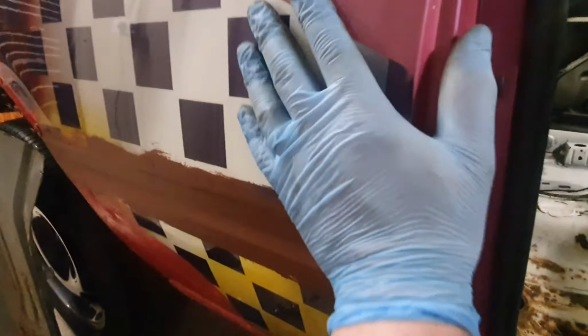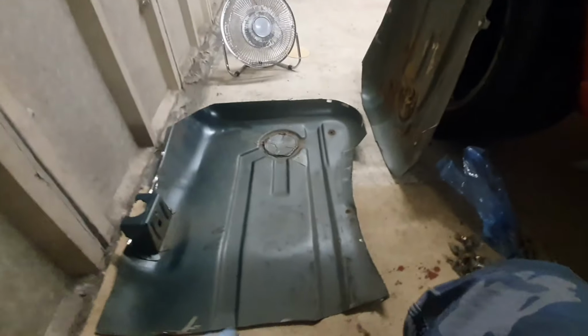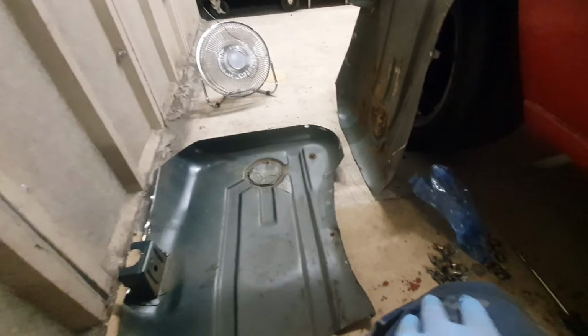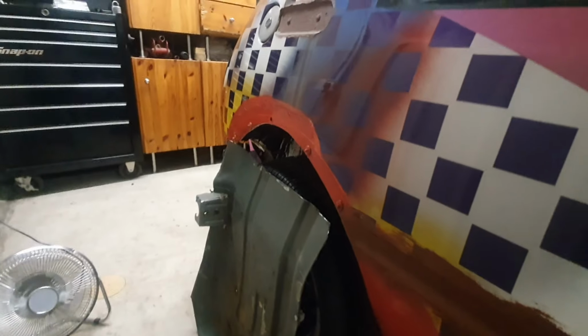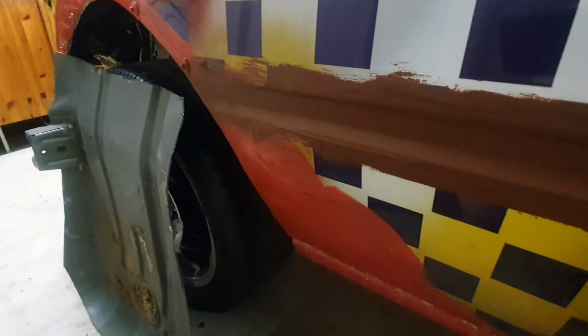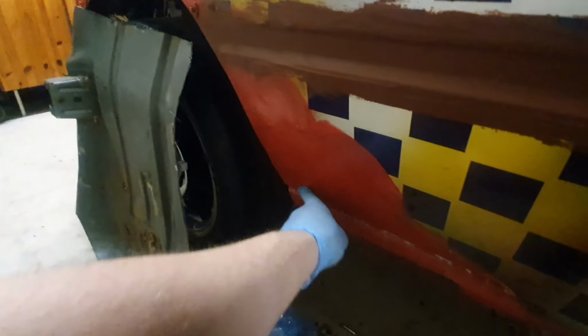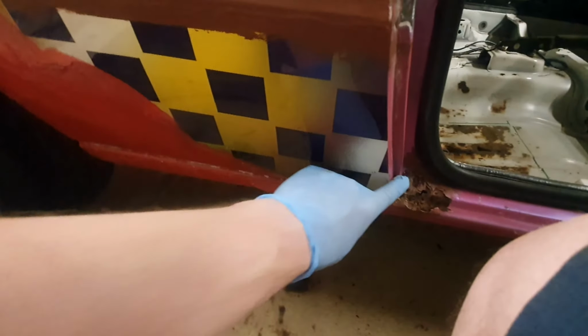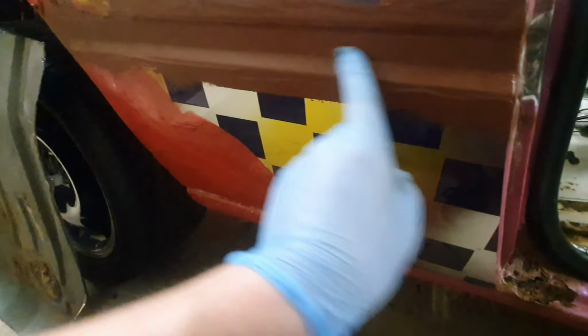So what I'm thinking is I've got two rear quarters that I bought. It cost me £100 for each side. Again, it came off a greeny coloured one, not off the same guy, which is kind of weird. Same colour car, but you know, I can't moan. So what I'm thinking about doing is cutting the rear quarters in this swage line, and the body kit covers that, so it'll be a lot easier to hide the welding. Then just taking off this entire bottom quarter, including this bit round here, getting the other ones off that other 205 rear quarter and putting them in.